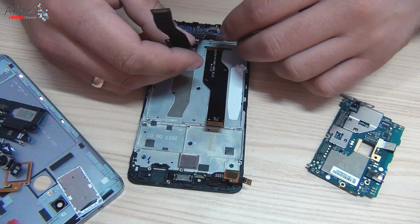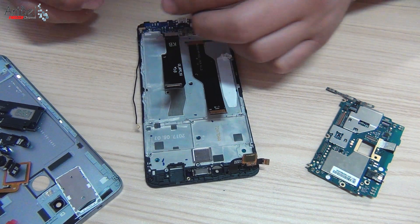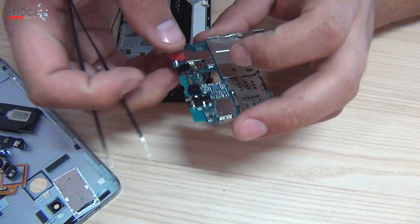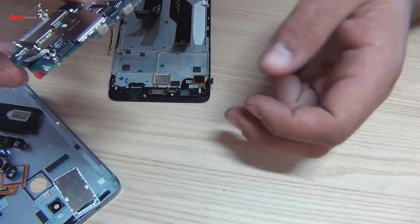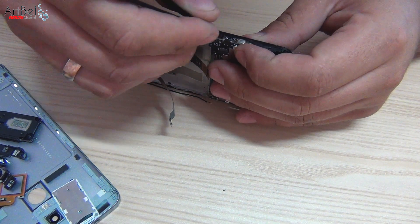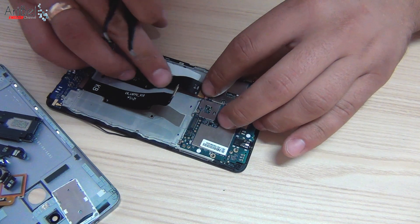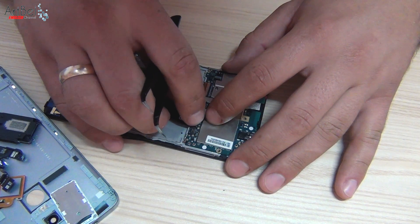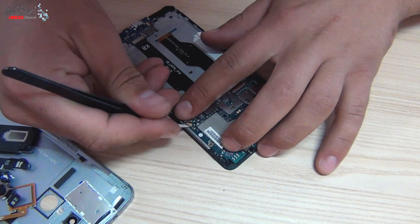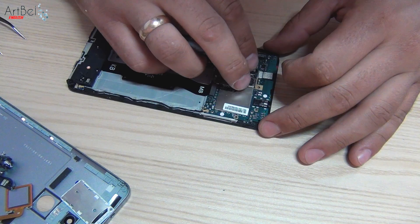Let's start to assemble. Install the bottom board and glue it. Connect the coaxial cable connector. Glue the touchscreen board with double-sided tape to the case. Don't forget to pull the rubber gasket on the main board if you removed it. Install the board in the case. Glue the power buttons and connect the cable. Glue the display cable from the frame, bending it near the motherboard so that the battery fits. Connect the cable, then connect the bottom board cable. Insert the antenna cable into its place and connect it from the top. Put the bottom speaker and connect the touchscreen cable.